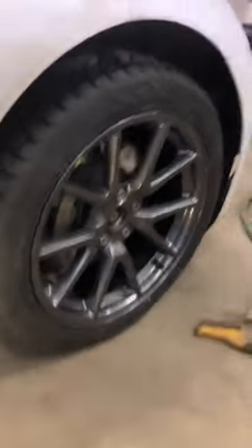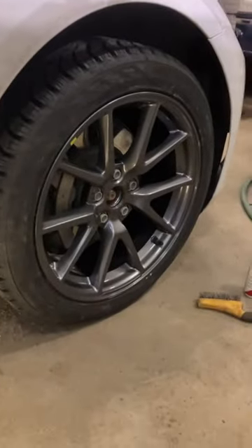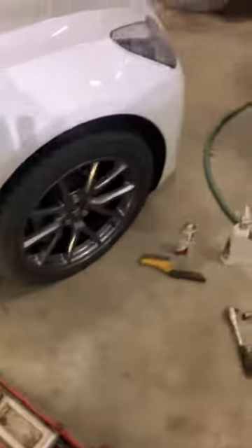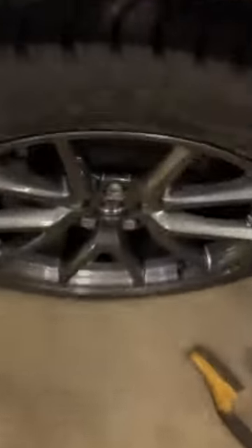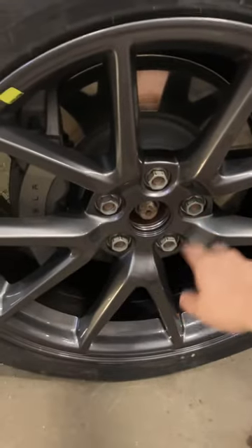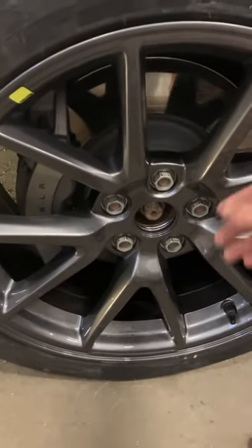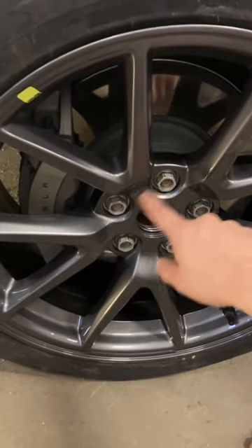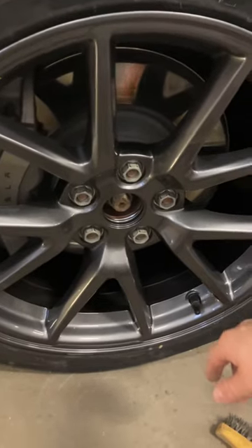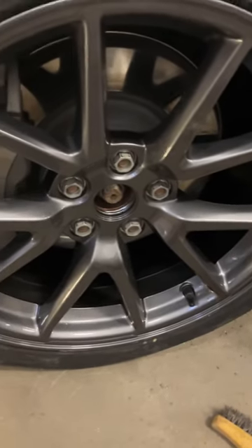If you fit it like this it won't hit the plastic, it won't hit the battery, so you can lift it up pretty easy. Don't be lazy when you change your tires — take the old tire away. Remember to clean the surface under the rims and put on copper paste. You will thank yourself next year when you change the tires back again.